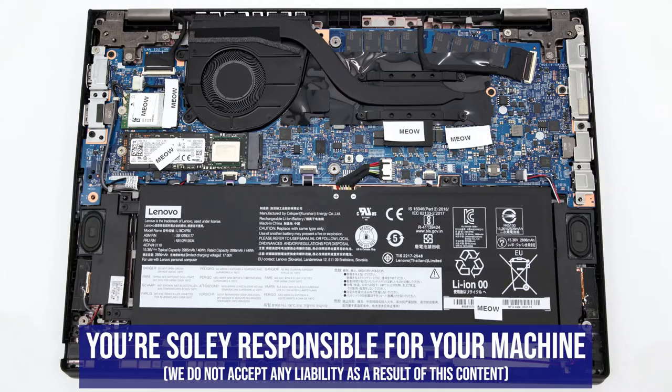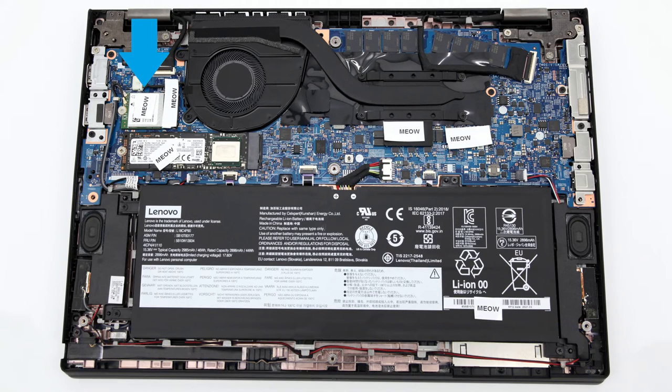On this laptop, upgradability is limited, so you can change the M2 and you can also change the Wi-Fi card. With the Wi-Fi card on the AMD model, it's swappable, but they give you a Realtek card, so not the Intel Wi-Fi typically. It would be nice to have the Intel option as an optional checkout. I would definitely have paid extra.